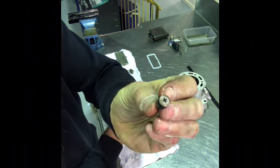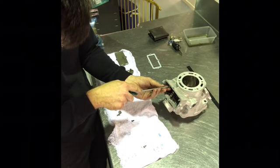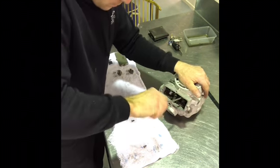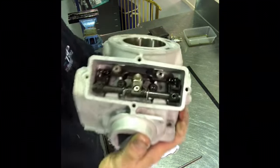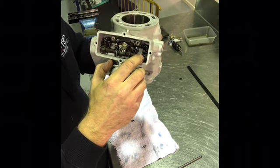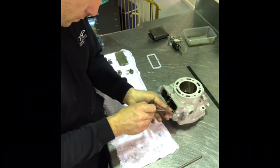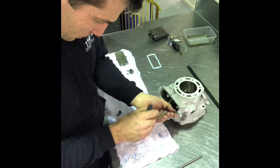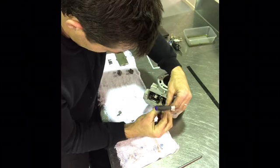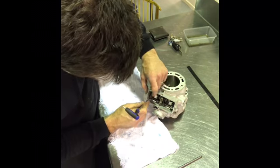So these screws that I'm talking about are just the standard Phillips heads, and they have a washer behind them. So that's done up now. So now we come back to these ramps and we finally put in the little 3mm Allen head bolts that mount these ramps to the main shaft. Just a little bit fiddly, I'll turn it back towards myself. Now, I'm not doing that up all the way. It's a little bit loose. And the same with this side here.